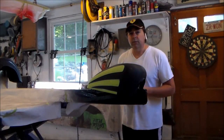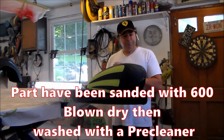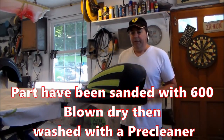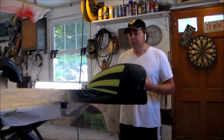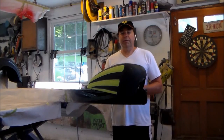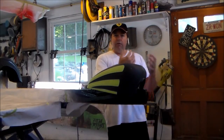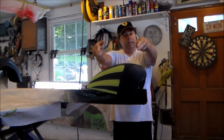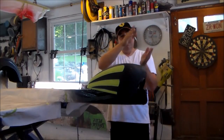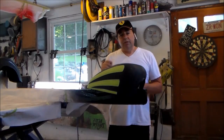Basically it looks like these points. So what I did was I took my fenders, sanded them with 600 wet and dry, got them all cleaned up, and then I laid out this design. Once you see it, you'll be very familiar with it. It looks like you've got your base color and then your secondary color extends — scallops extend like points. So you don't have all the intricate flowing that you would have with a flame job.